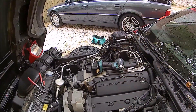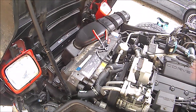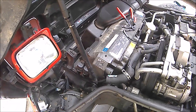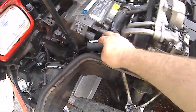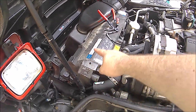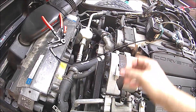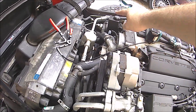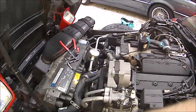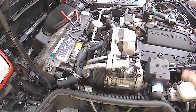We've already cycled the flush through there for 10 minutes. Shut it off, let it cool down to about 160, and then drained all the water and flush. So what we've done - I'll time-lapse here in a second - we take this hose, stick it in here, and spray the water into the radiator with the petcock closed. The water pumps up through that lower radiator hose and into where the thermostat used to be, then flows right out there. As we start the car and let it run, we got anything in the block out, and now it's just mostly clear water. I'll time-lapse and show you what I did.